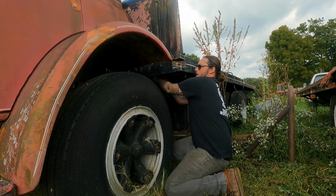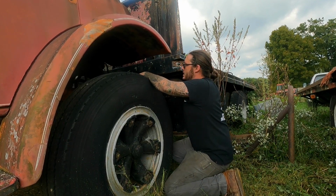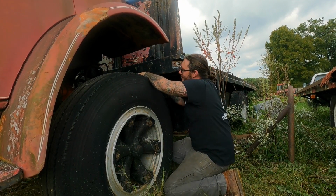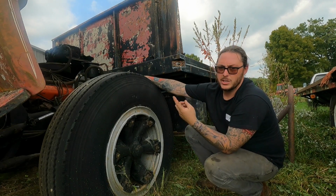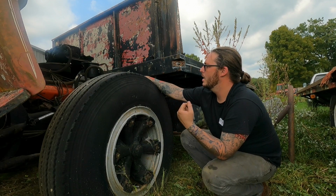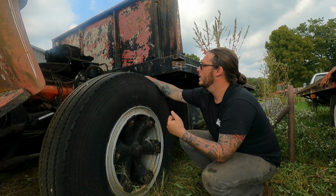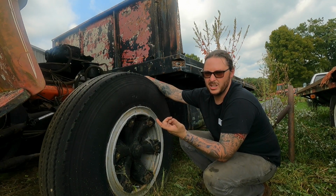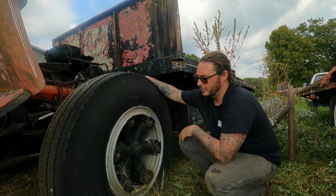We managed to get brakes. Well, we have pedal. I can't say if we had brakes or not. Still no clutch, but that's not gonna break my heart. Gonna drain the oil, pull the distributor, prime the oil pump, change the oil, prime the oil pump, put a battery in it, try to work out the clutch, and hopefully drive this thing home.